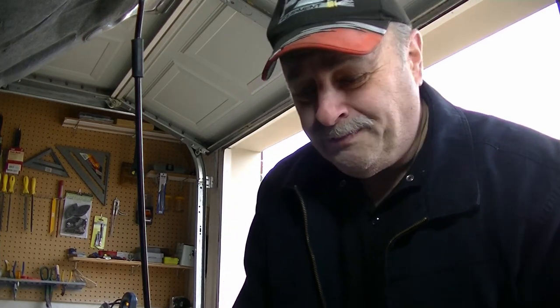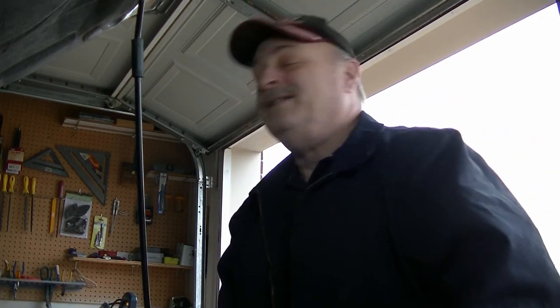So if I'm going to do any more fluid changes on this Audi, which I am, it's going to be done through the dipstick. And I got this pump somewhere in this garage here, one of those can pumps. And I'll just pump out that fluid, then pour it back into the dipstick. That's what I've been doing anyway. Since this had the recall on it back in 2005, they used the filler plug up here. It's way down in there. They put this little bypass so that fluid can go up over the second gear and the tranny. I don't know. It's all high-tech stuff, you know.